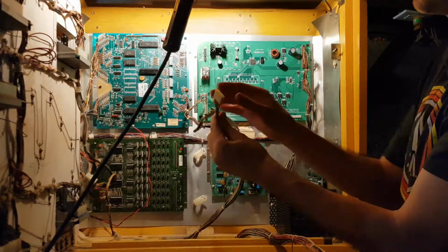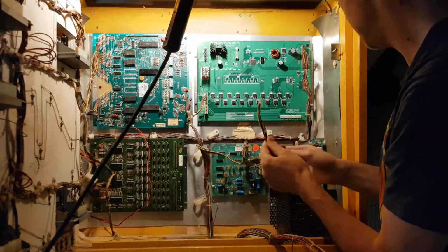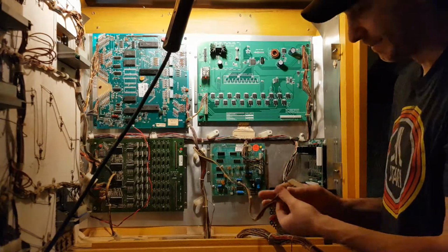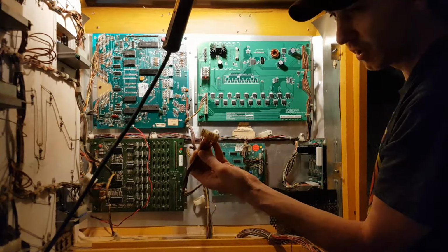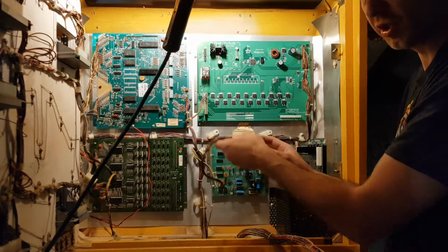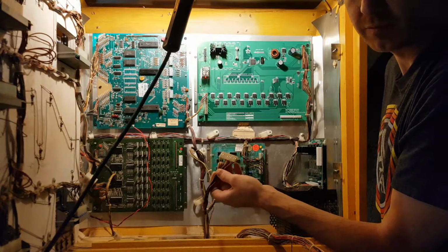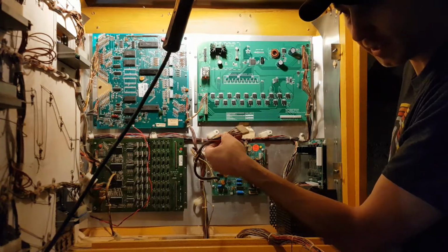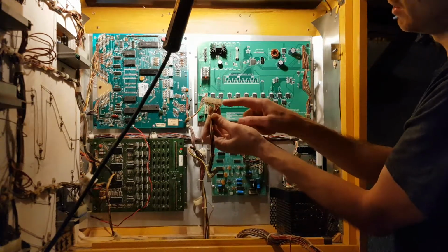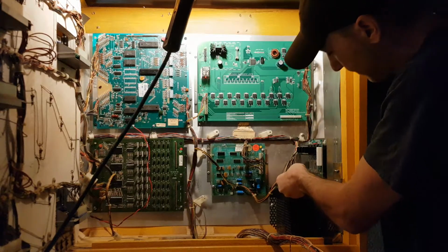Let's pretend that it's not labeled. Okay, this is a big connector, it's a white one. Where are the big spaces left? Here's a big space. Oh, on the power supply over on this side. Now, make sure you get this right. Usually it's keyed. If not, make sure you look at photos on the internet if you don't know for sure. Compare. But you don't want to put in any connectors, especially in the power supply, upside down. This says J2, right, so I know that goes on the right side of the power supply.